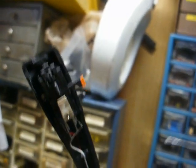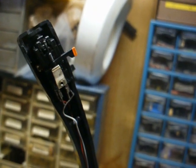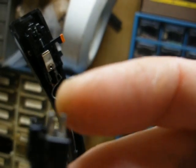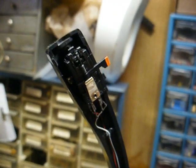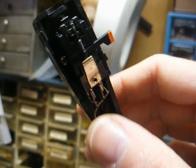On a more positive note, the cartridge connector pins seem to be more stable on these newer P226s. On some of the older ones and the Crosley-type cartridges, the pins were physically loose — I've even had some that would push up into the body of the cartridge when I attempted to connect the clips, and I'd have to put a dab of glue on the pins to hold them in place before connecting them. The pins on these newer cartridges seem to be more stable, but still, if you order a new cartridge, pay attention to the pins, and if they seem a little loose, put a dab of glue on them before you slide the connectors over them.